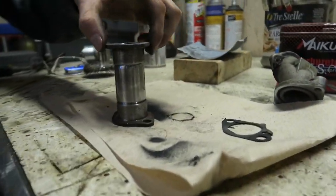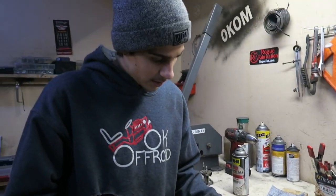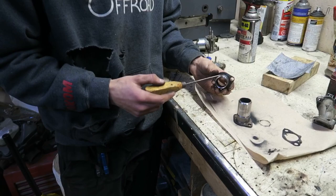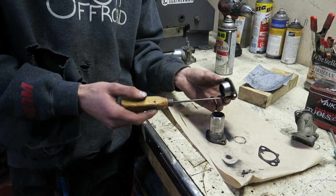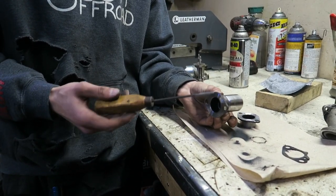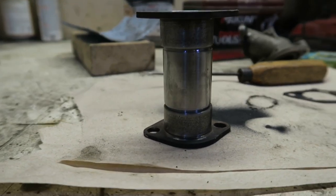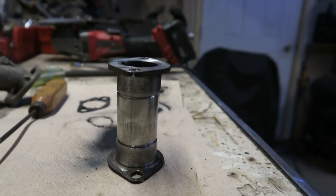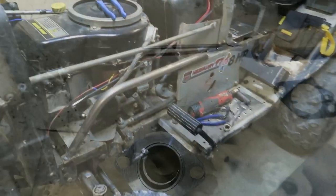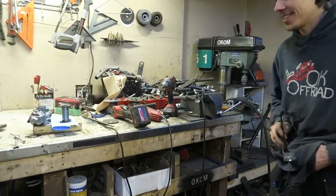Check this out. So we laid down some parts, made a few parts, still got to do a bit of welding on that seam there and on this seam as well. Then we have to clock these in the right position — one side will go to the engine and this side will go to the new carburetor. While I've been taking the old carburetor studs out and doing a little custom work, Riley has been on the lathe, on the welder, all over the place.